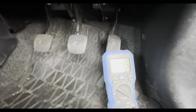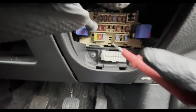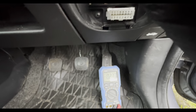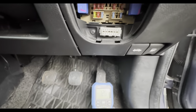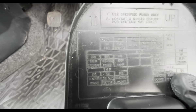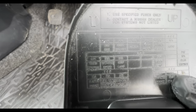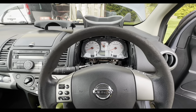So I've just went ahead and done the millivolt test, the volt drop test across the fuse. And on there, you can see that we've got a high millivolt reading across that fuse and across the 10 amp fuse. And that fuse is for 10 amp electronics, so we're going to need to figure out what's on that circuit. So this one's a wee bit of a pointless video, but I thought I would finish it up anyway,